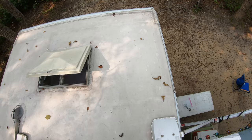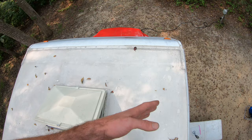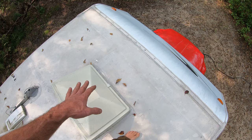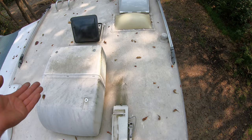The biggest key to these truck campers is you have to get up here frequently and make sure to reseal this any time. You can tell somebody's done a pretty good job resealing this at some point, but you've got to make sure you don't let water sit up here and drain in — because by the time you notice water leaking inside the camper, it's too late. These things delaminate, they get rotted walls, mold and everything, and then they're not worth anything.